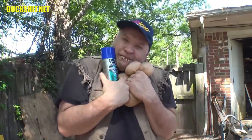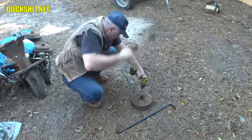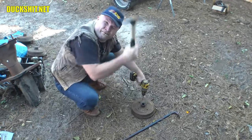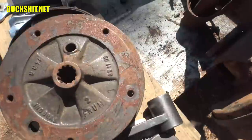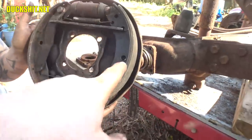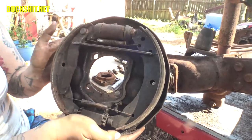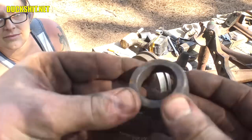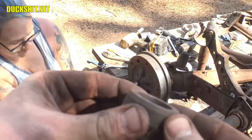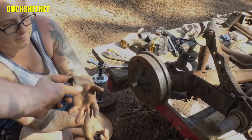You could buy a set of drums retrofitted as wider late-model equivalents with 5-lug holes already drilled, or have your existing 4-lug drums drilled by a machinist — but this is likely much more expensive if you have an abundance of older classic parts laying around. You'll need the rear backing plates complete with shoes and a working wheel cylinder. I recommend replacing the wheel cylinder almost always, as they're only about $10 each and will save you a lot of headaches. One last critical thing you'll need is the axle stub spacer that goes under the nut, as all later-model Volkswagens had longer axles. So let's start tearing some stuff apart.